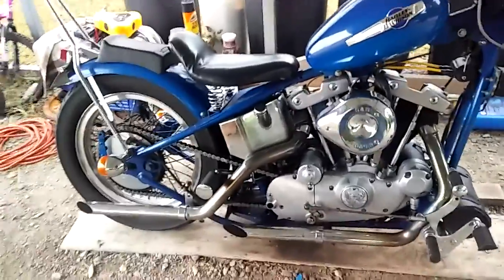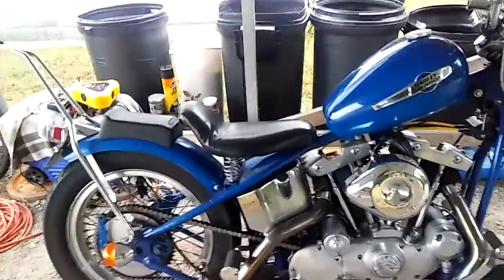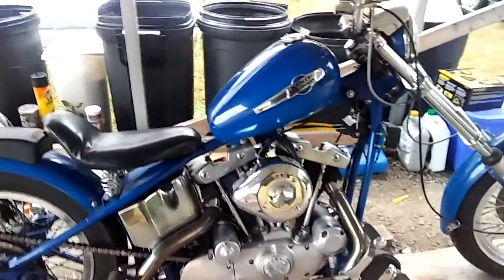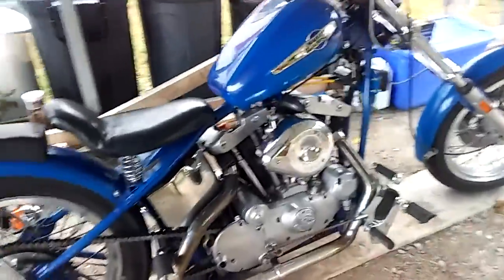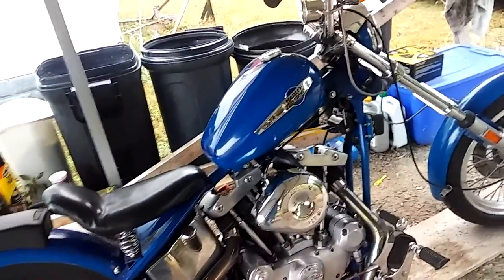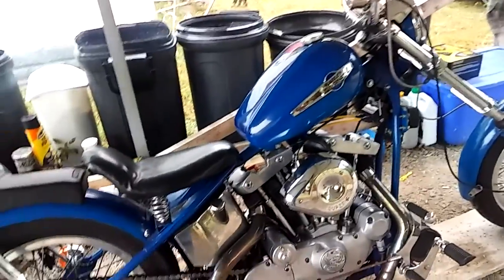But yeah, so typically you can pretty much get away with mostly anything with a charger, a multimeter, and just properly storing your bike on a proper surface to where it doesn't wear your tires out, things like that. And putting a little bit of Lucas oil treatment in there, it'll get everywhere inside there, and it'll prevent the rust over the winter time.